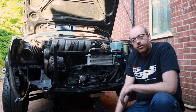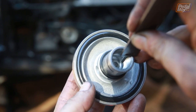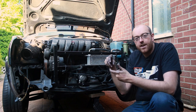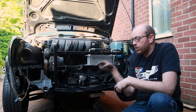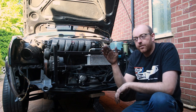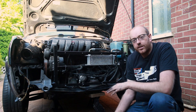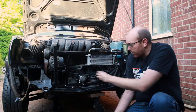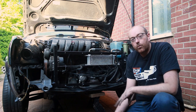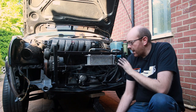So that's the sandwich plate installed. I had to trim the inside of the cap down — those female threads go a lot further than the OEM pipe does, so you can trim a little bit off the top without losing any thread contact. If you do need to take a little bit more off, be very careful about how much thread you have left, and you'll need to trim out the threads on the cap itself to make sure the body of the tube goes all the way down so the flange comes right up to the top of the female thread. I can't test this right now because my oil hasn't arrived — it's still on back order — but I'm pretty happy with the seals. With that all in, I can now put the radiator in and get everything buttoned up.